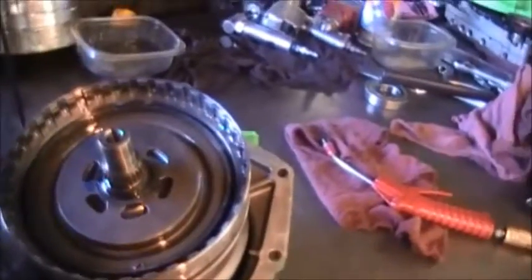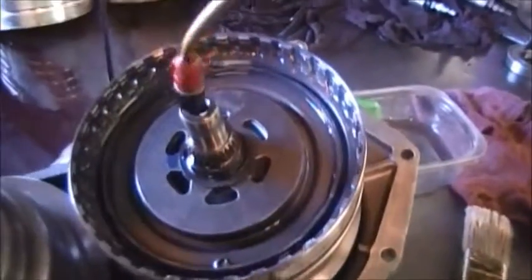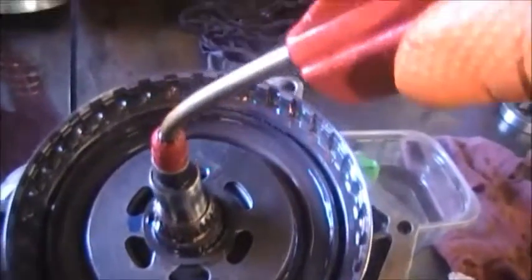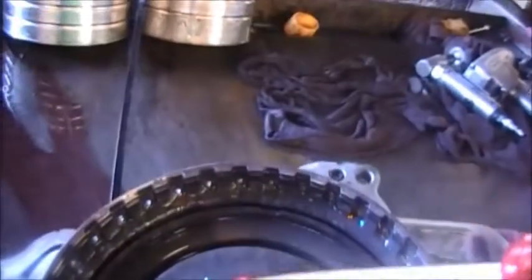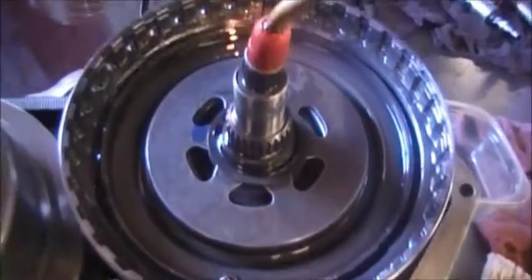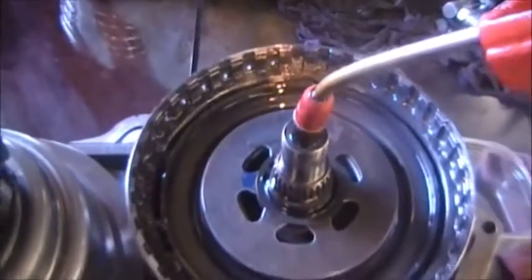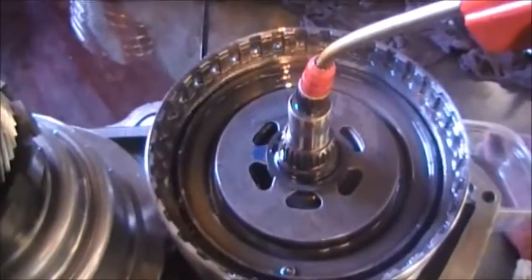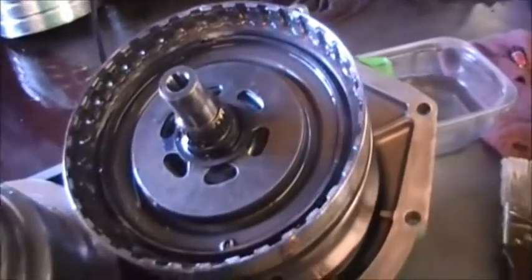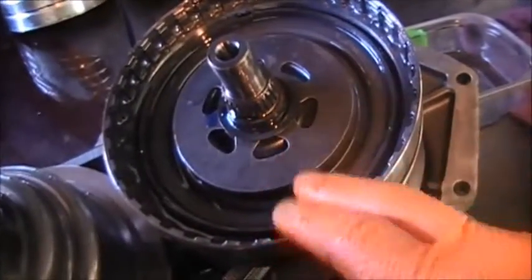After taking it back apart, I'm going to show you what it was. I'm going to put a little oil around here so you can see. If I blow in here, you will see the air bubbles coming around. There are air bubbles and it's not applying. I even put more pressure in there — if I put more pressure, then it applies. That's not good. I'm going to show you another one where the seal is good. I'll end up replacing this anyway, but I want to show you one where the seal is good and how easy it should apply.